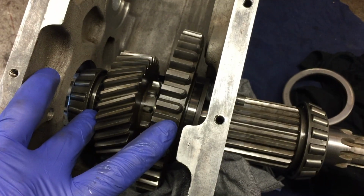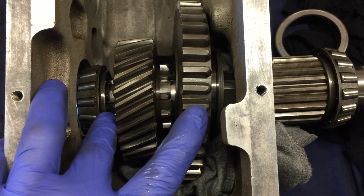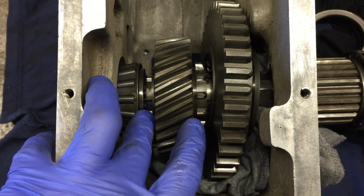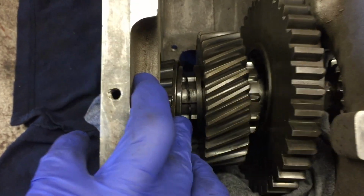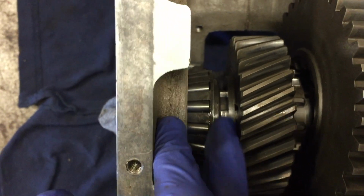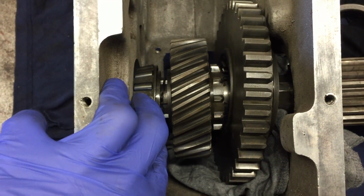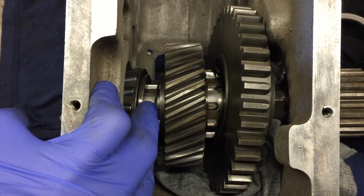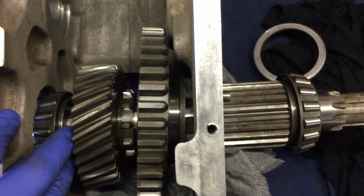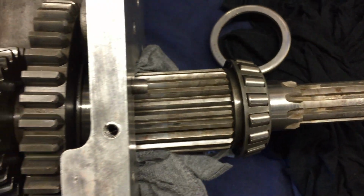So we have the lower gear wheel on first, with the selector fork heading towards the back of the car, the output. We have the high gear wheel next, followed by, if you can just see in there, a thrust washer. Oops, sorry, can't quite see. Just in here, and then the circlip and the bearing. And we'll slide all this on until we get to a point where we can actually push the circlip into the slot that's in the shaft. And then put the bearings in, bearing casings. The bearings in, it's just the bearing casing on the outside there. We'll be tapping that home.